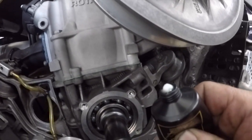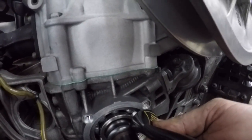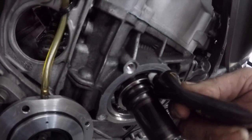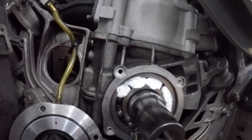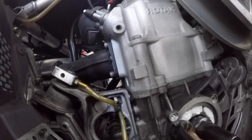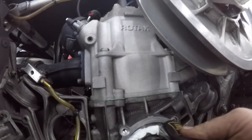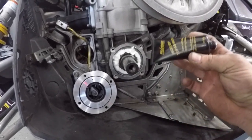We are going to pack this whole race here full of grease as much as we can. So here we go — a little bit of liquid but not too bad. I'm just going to press this tight and work my way around packing that grease in. This is special grease called Isoflex — this is the stuff you want to use. Yes, it is crazy expensive. I don't know if another grease can be used like white lithium as an alternative, but I wouldn't do it. Sleds are worth way too much to gamble on grease.